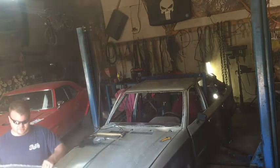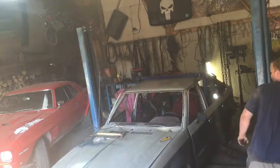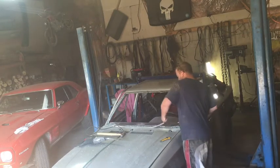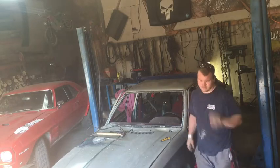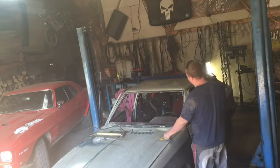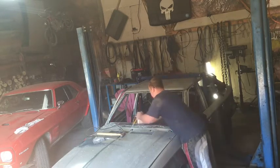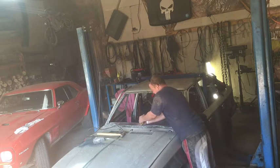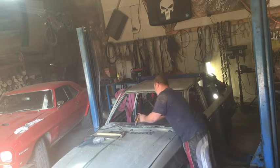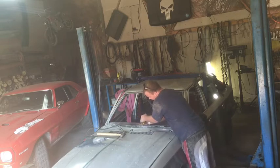Now this one does have a chrome trim around it, so I guess I do need one more tool, which is a flathead screwdriver to remove the chrome trim. Now, just grab our X-Acto knife and go around and remove the excess glass. I just start anywhere. Now this is where you've got to be careful — I guess this would be good to have welding gloves on or any of that fun stuff, so you don't cut off your arms.